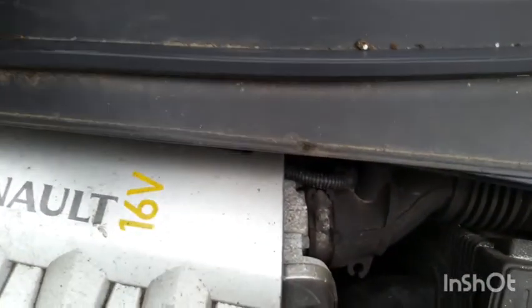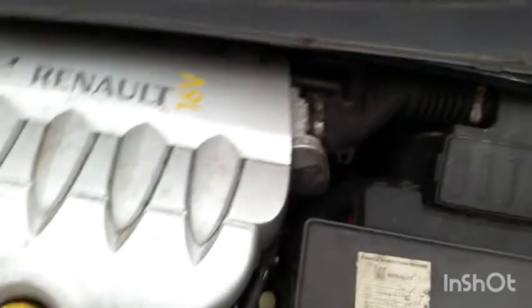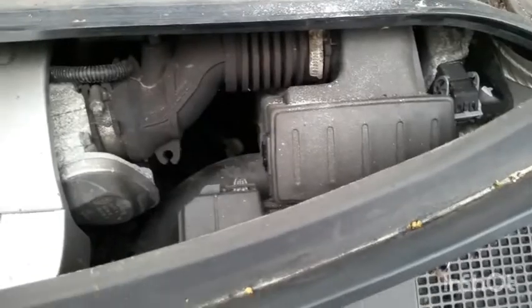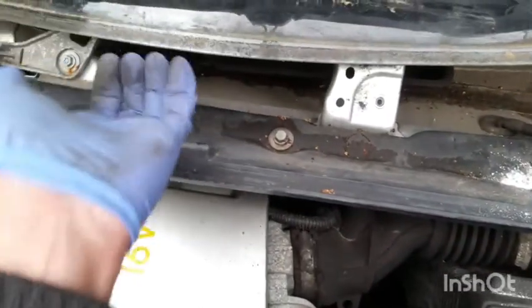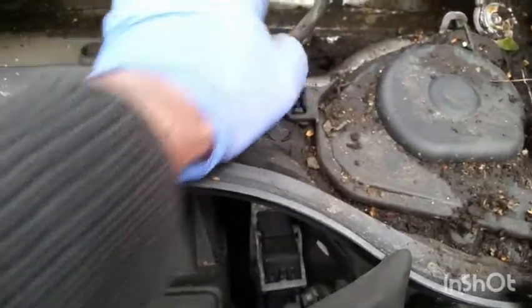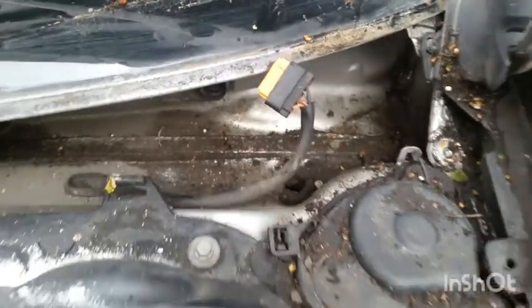First of all, you have to take the wipers off using a 16mm socket, and then this comes off, and then there's another plastic bit here on top of here. You just put your hand under it and pull it, lift it up, and that one comes off. And then the motor is here. To take it off, there are just two screws. This is the motor. Two screws, they're 10mm, and it will come out, and you just need to disconnect the connector.